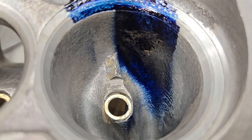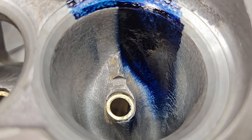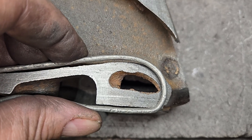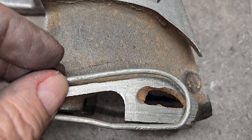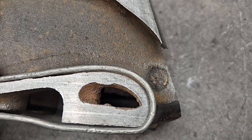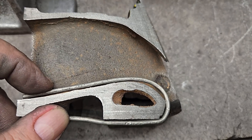What I wanted to do now was — this has been fully ported, but it hasn't been scienced out. So our short side, when you put the bigger valve in, you change our profile on our short side quite a bit; it's kind of standing up quite a bit now. It's an interesting demo because in reality it's moved more like this because it's got a bigger valve in it. Obviously you need to be careful of this — you can't just bang away at it. Because that's a curve right there, it's going to be tough for the Sonic to figure it out, so I would definitely err on the side of caution. But if you take a look at this versus the stock design, I'm pretty sure we're going to need to do some layback on that. There hasn't really been any layback on it yet, but the speeds across it are actually quite good until it loses it because it's so stood up.